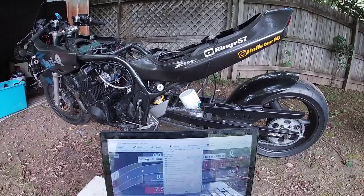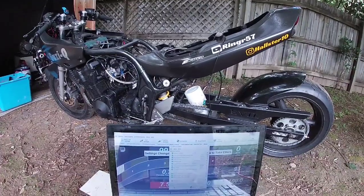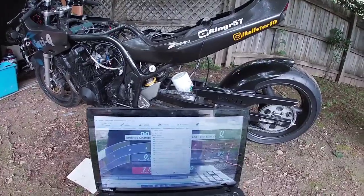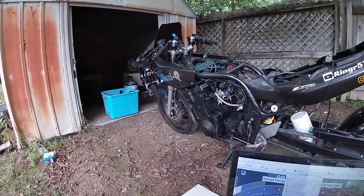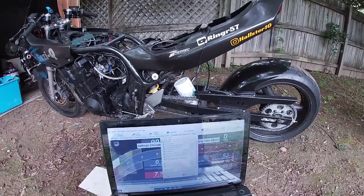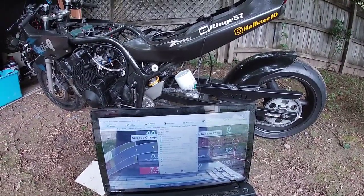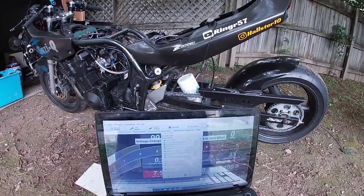Additional pulse width at nitrous minimum RPMs. Tapers down between min and max. Well, I'm going to do one. I don't know, 0.8. This pulse width is usually like 4. I've got to educate myself on this. This is for the dry. Retard ignition by 8 degrees, no. 3. Much, much smaller shot. Nitrous won't come on for 1.5 after.